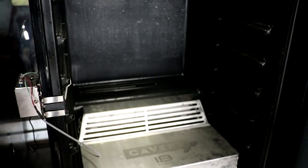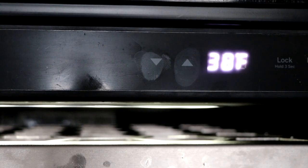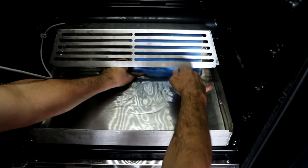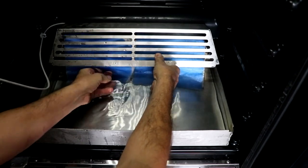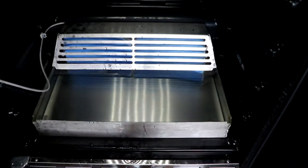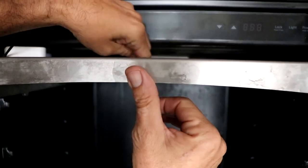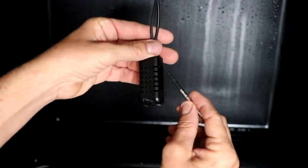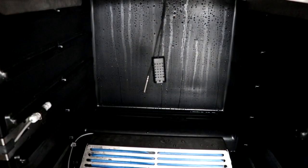First thing we've got to do is lower the temperature of this wine fridge all the way down to the lowest setting, ensuring it always cuts on when our temperature controller tells it to. In the last video, we removed several of the filters trying to control humidity, and that didn't work, so we're putting those filters back in their appropriate location. I kind of like this basin with the filter setup — in a month of testing it's barely used any water. Now let's put in the sensors for the temperature controller and the humidity controller, placing them right in the center of the box.